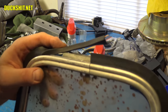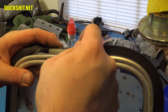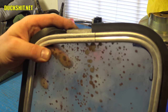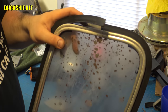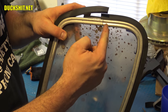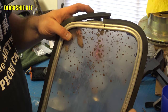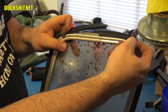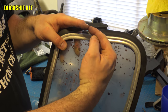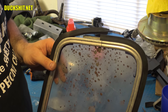All right, we're doing pretty well right here. You notice I brought the black rubber seal just a little bit past the seam here, and there's actually a lot of slack in it right now all up through here. So what I'm going to do is take this piece and pull it just a little bit past that line and continue to tuck it in, and then I'll pull some slack into this here and get these two pieces butted together, pull the slack out of it so that they're mushing into each other with a little bit of crazy glue in between, and that will close them up.